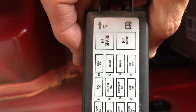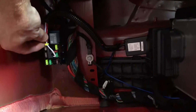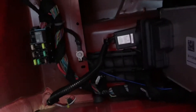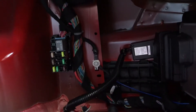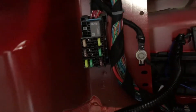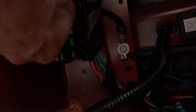Take the lid off and it tells you which one's which. The FSCM fuse is this one right here. Of course you have the spares and everything. I need to disconnect this — it's for my NPP exhaust, similar to the mild/wild except it's one I made. I bought the remote from Amazon, same remote, wired it a bit differently. Anyway, it's not a relay, it's actually the fuse. I need to pull this one — it's a 25-amp fuse.